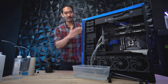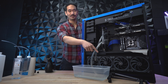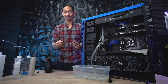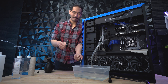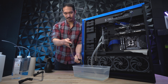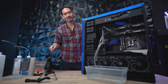And just as easy as that, we've drained the entire loop, which includes the radiators and the reservoir. But you'll notice there's still some liquid inside the water blocks and those tubes. For the tubes, we have two female fittings — all we need is one male fitting to release the liquid. And same with the other one.